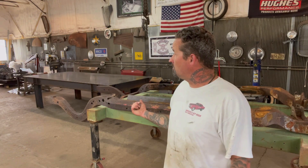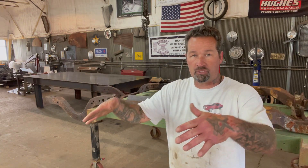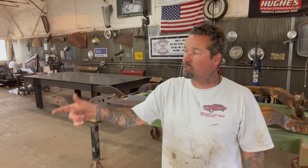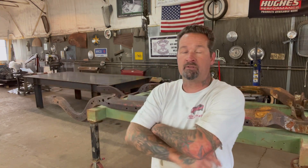I'll try to do it like a vlog — kind of an everyday thing working on Rogue. I have the hood started but I have to do the edges on the English wheel and get it all shaped — a lot of hammering. And the doors: I got the door hinges here. I'll get those installed and finish up the tops of the doors. There are some shapes on the tops we wanted to do and we just haven't done that yet, but I think I want to match the cowl so it goes all the way back down the sides of the doors.